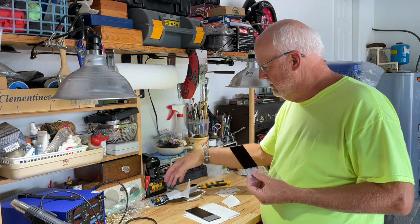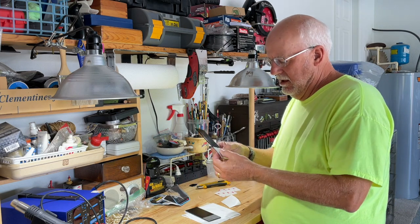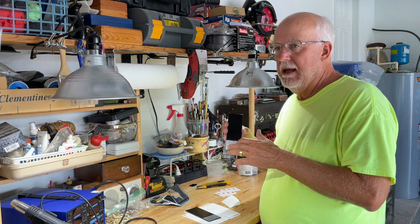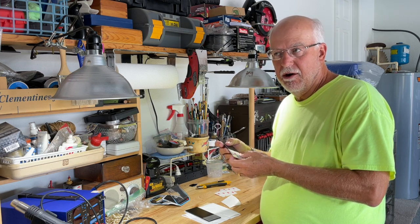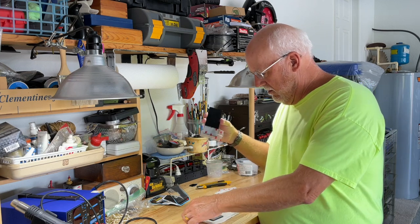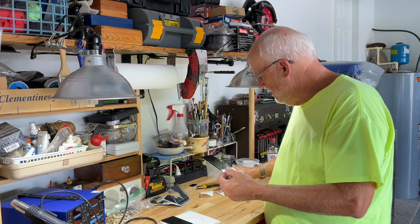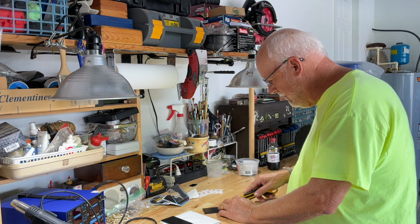Okay, as you can see here, I put the 3M clear mount sticks on, and just make sure it's on there good. You can buy these at the hardware store, but they also have one that's even stronger bond, or you can go to an auto parts store. They have the same thing there. I think these will be good enough. So I put it onto the metal. Just make sure it's very well stuck onto it. Get yourself an X-Acto knife and then just cut off the excess.